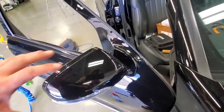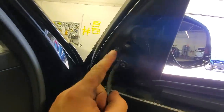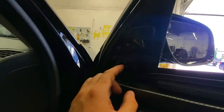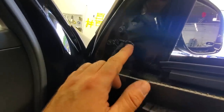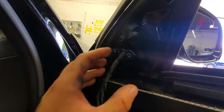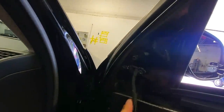For my 211 chassis guys, if you want to update to the newer style mirror, you do have to do a little bit of drilling. You're basically remaking the mounting points — I had to drill little holes in the actual door and line these up with the factory threads in the new style mirror. There's a little foam piece in here that you can use as a template; it fits in perfectly, then you make your little marks on the other side and drill it out. That's about it — it's pretty easy.